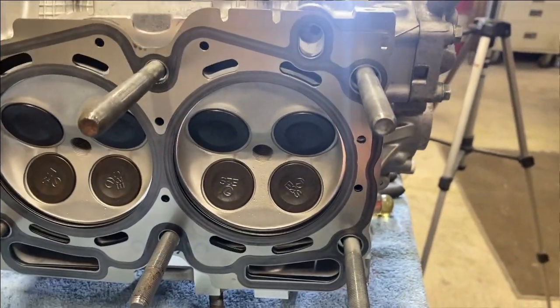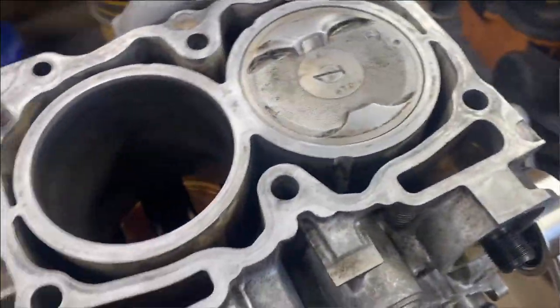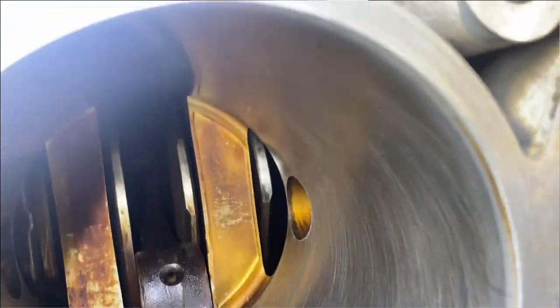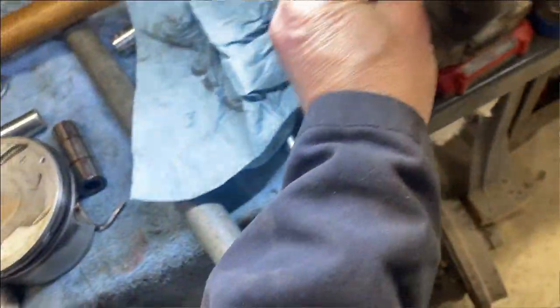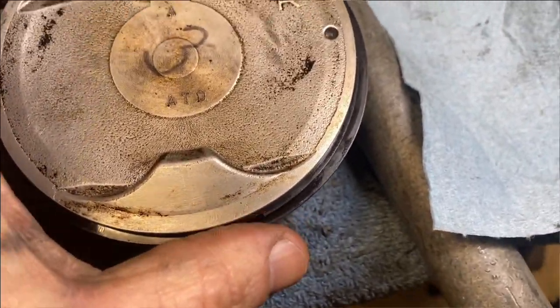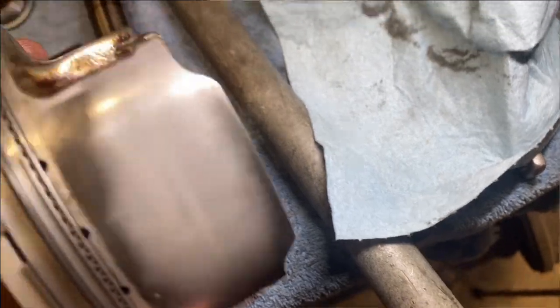It seems like from when the air's leaking, the problem's not with the valves. So I'm looking at the cylinder and I wondered if I had kinked a ring, scratched the cylinder wall. All the honing looks good. I don't see any problems there. So I was looking at the piston with the 3 new rings in. Top ring split is there. Bottom ring, the split's there. Got the logo up in both of them. It's just the way they're supposed to be.